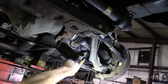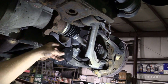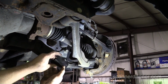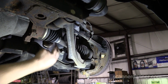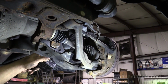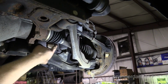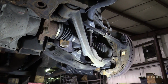You got new shock mounts. Are they offset somehow? Let's go look. So anyway, yeah, these do look offset. They look like they might be a little bit higher, but you can see the taper here to here. My guess is maybe they went this way so your shock doesn't run into here. When you lower this down, it has a chance of the shock running into the bumper block or something. So we'll have to look and see the orientation. Mainly that bracket is to give you a little bit more shock length. I don't know if it's more length or more about getting the offset away from how close it is already to this bumper block and that part of the frame, to kick that shock out of here.